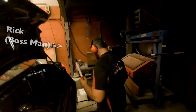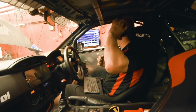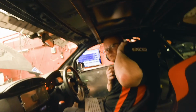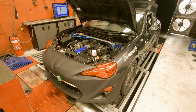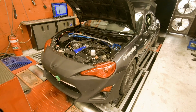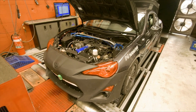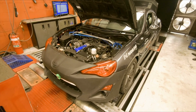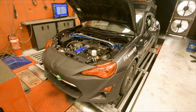No fuel pressure drop off, that's interesting. Did that lean out this time? No, it's back to where it is. I didn't think the filter was blocked enough to cause that. No. I flowed through it, but see how it goes. 30 kilowatts down, 3-0.